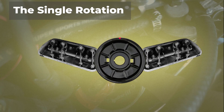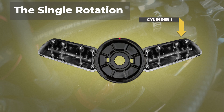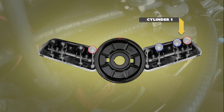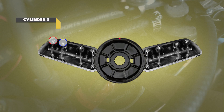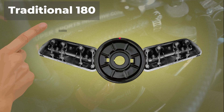If you've ever wondered why the pulley has no 180 degree mark after decades of maintenance, it's possible this faster method was used. At cylinder number 1 top dead center, you'll find the intake valve on number 2 and the exhaust valve on number 4 are also closed — you should be able to feel the play. That means you can adjust half the engine valves right there: both valves on cylinder 1, plus those two. Then rotate the crank a full 360 degrees to bring it to cylinder 3 top dead center. Now the other two — intake number 4 and exhaust number 2 — will be closed, and you can adjust the remaining half. No 180 degree mark needed, just one full turn of the pulley and the job's done. Leave a comment with which method you use: the traditional 180 or the single 360.